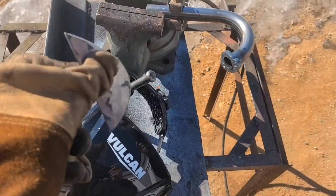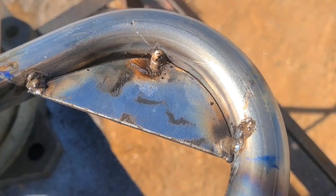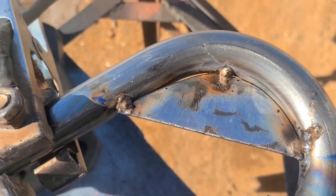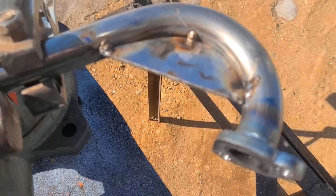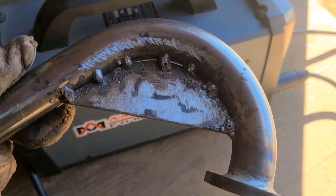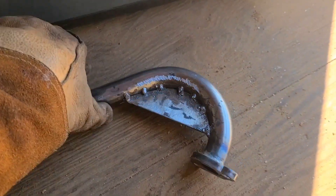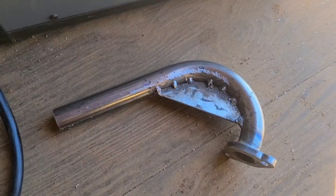I'm running 70-18, why not. I have it tacked up — I could have done a little bit better at getting my spline fit, but I'm just going to roll with it; it really doesn't matter. I'm going to be putting some tack welds — they're going to hold this thing in place, it's not going anywhere. I went hard with eight tacks on each side that way I didn't add too much heat to any particular point at any given time.